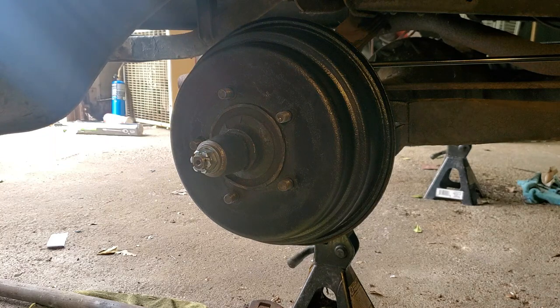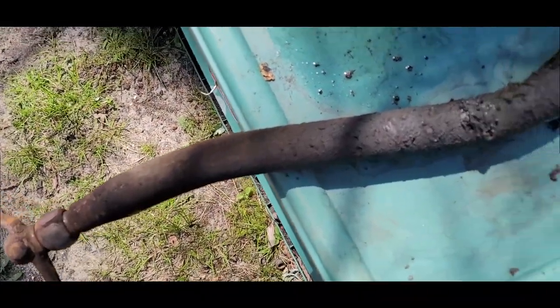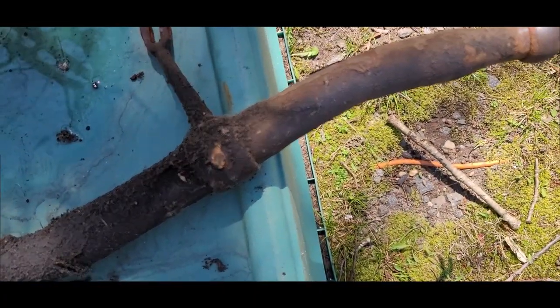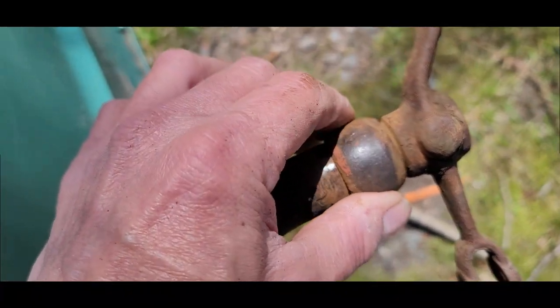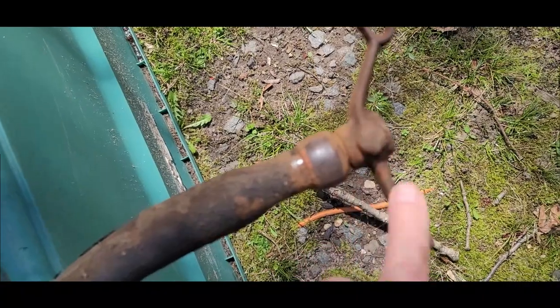Now, I think I'm on to the service brake crossbar up under the floor there. I took it off to replace the bushings. That's where I'm heading now. So I got the brake cross shaft out with much difficulty. One bolt you couldn't get to. You can see the bushings are worn. I hope the shaft isn't worn because I don't want to get involved in taking these off.